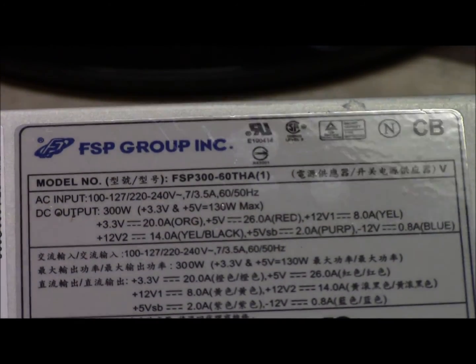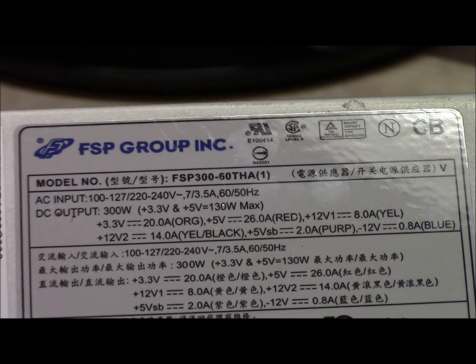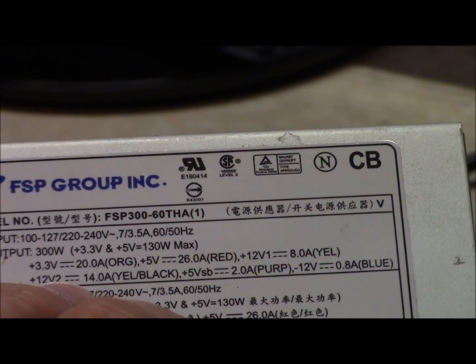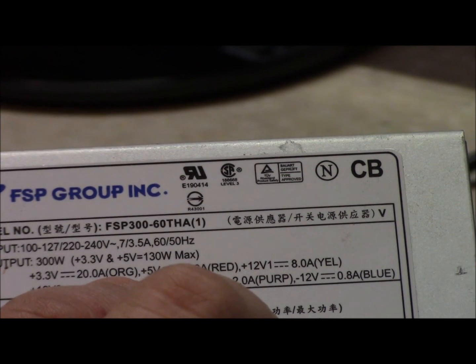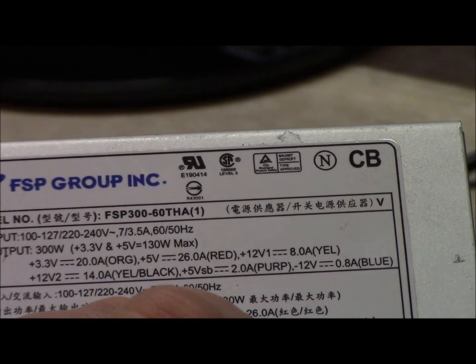It's not a very big one — it's an older one too. Your newer ones provide a lot more current, but you can see at the very bottom line here the 12 volt positive power supply side of it. The high power one is 14 amps, and the wires are the yellow and black traces. You can also see it has a 5 volt out, so you can actually take the 5 volt out and use it as a USB charger if you decide to cobble together the cables.